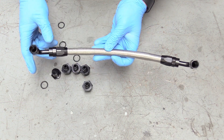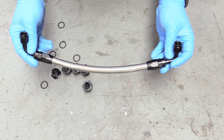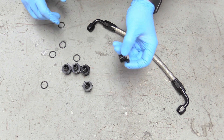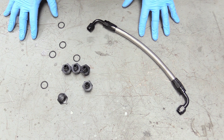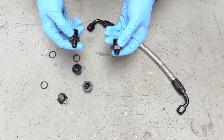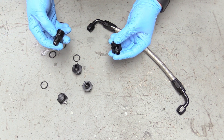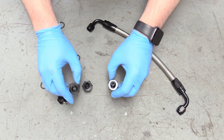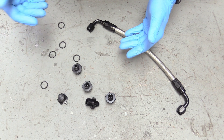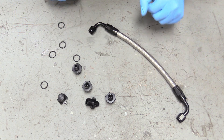The next thing we're going to talk about is our fuel line crossover. This is going to link our fuel rails together so you don't have to run two separate lines. You can set it up in a dead head style and put a plug in one of the ends so it's regulated at the fuel pump. However, the better way according to most fuel pump manufacturers is to use two fittings — one on each side of the fuel rails — to send and return gas at a metered rate. It's a little more work but it's the better way to go. The really cool thing about this system is it's completely customizable — you can have the fuel feed in at the rear or front in one corner or the other.